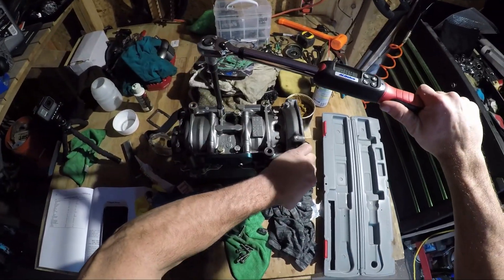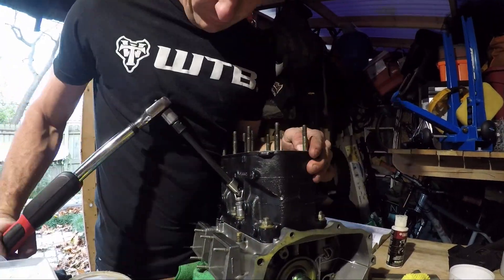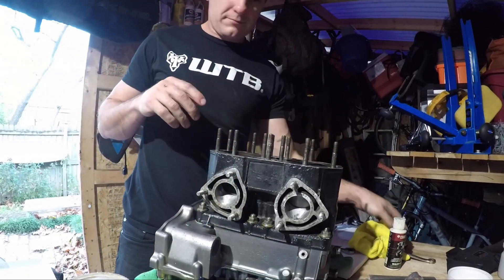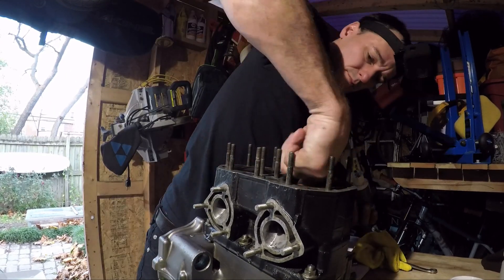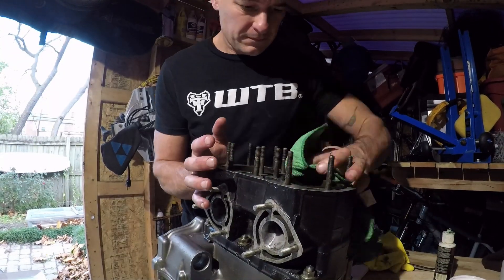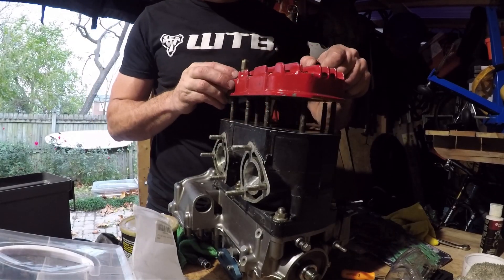I followed the manual for torque specs, but did cheat a bit on the cylinder body nuts. Since I didn't have a crow's foot socket, I torqued one of the more accessible nuts and got a feel for it by hand, then applied roughly the same torque to the rest of the nuts. It isn't precise, but I'm satisfied it'll do. Since this engine will likely sit in the shed until spring, I decided to apply engine assembly lube to the cylinder walls also, to protect the surfaces and ensure a trouble-free start a few months in the future. Other than that, reassembly is very much the opposite of disassembly, just with new gaskets and seals. I'll see you next time.